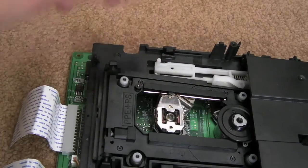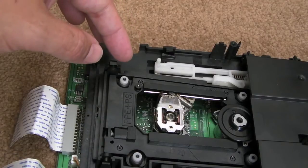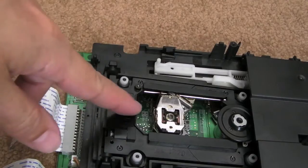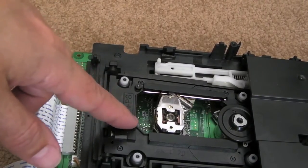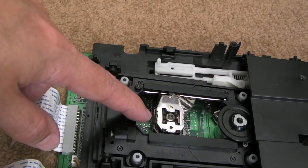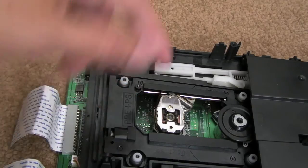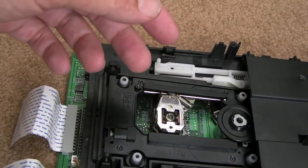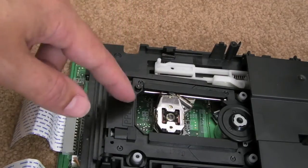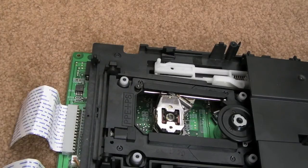I cleaned the laser a couple of times with isopropanol after installing it — that made no difference, but it's now nice and clean, and that's another thing you should consider doing before you start trying to adjust the pot. The rule of thumb is to start with a pressed CD — if it can't read a CD audio disc with no scratches on it, you don't want to be playing with laser voltage unless you know the laser is definitely on its last legs. You could set yourself up for a world of pain if you don't do it in a controlled way, making a note of the resistance value and position.